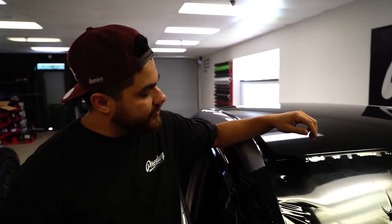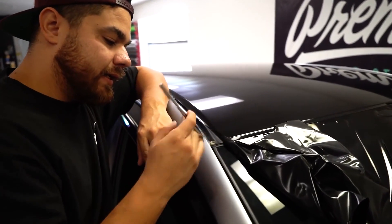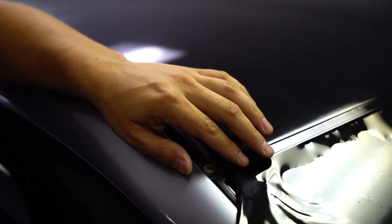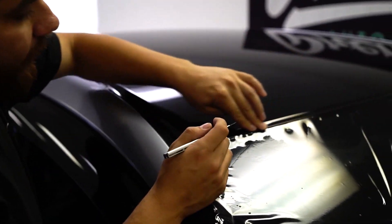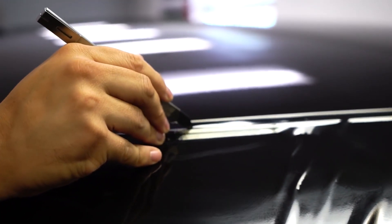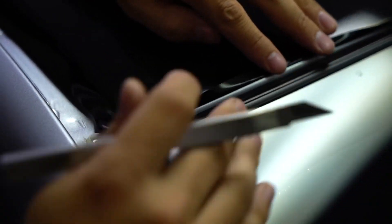When it comes to trimming out the front and the rear, every car is going to be a little different — so you want to be aware of what's around. You don't want to cut on any rubber trims — you don't want to put your blade right on this rubber piece and cut it; you'd actually destroy it. So what we do — as long as the car is suitable for it — is we're going to use this rail right here, but we're not going to cut on the rail. We're going to put the side of the blade inside the channel and use it as a guide, cutting in open air space. Here's where my blade traveled, ensuring we didn't damage anything — I put the blade right up against this to use as a guide and worked my way through. No pressure down, no pressure on the side — just using the side of the blade as a guide, which allowed it to not damage any of the trim.